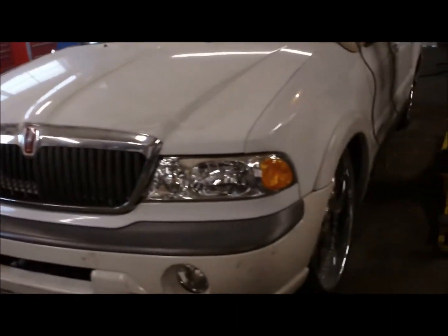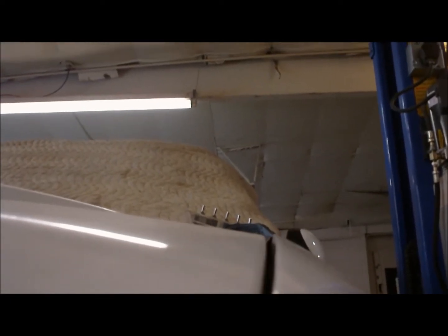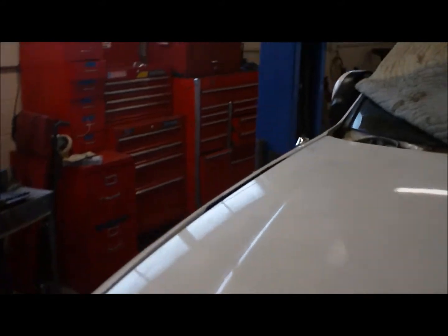It's coming along, getting there. The tire — as you can see, it's kind of hard to tell — but the fender is sitting a little higher than the hood right now because the hood actually gets pushed up by the tires. So I'm gonna remake, I'm gonna reshape the hood basically so it's gonna match the fenders in the end.